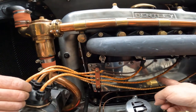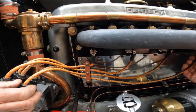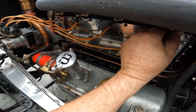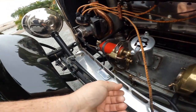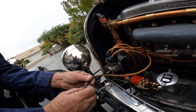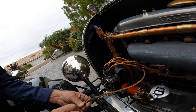That'll shock you. So these are the two I think that are missing back here. And this wire is a little burned up too. This one's burned — so the insulators burn up. This plug wire — this could be our issue right here, because this plug wire is burned up. It's melted through actually, all the way. So that could be our miss on cylinder number four. It's arcing. I heard the arc too.